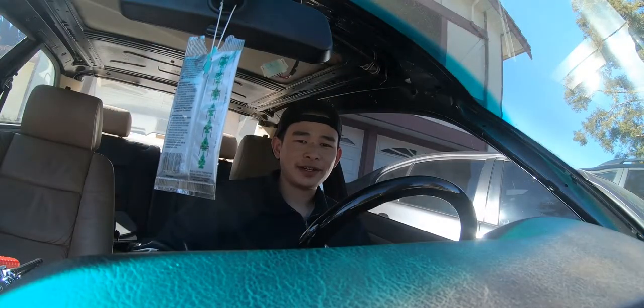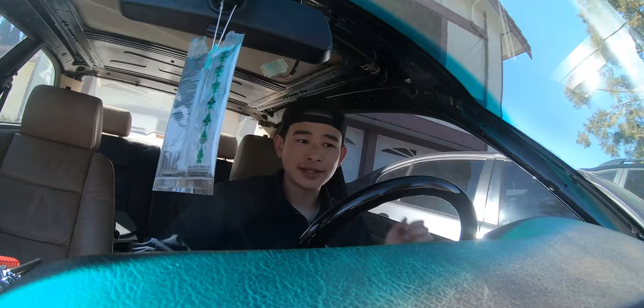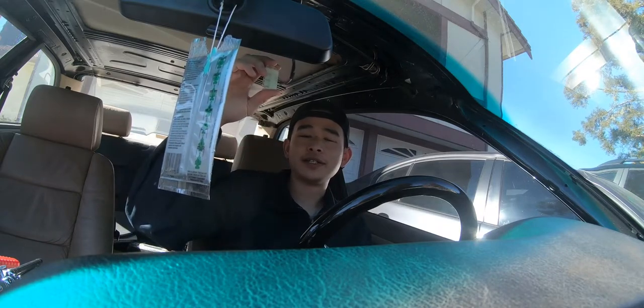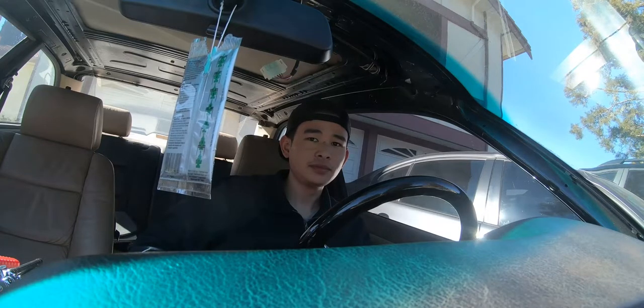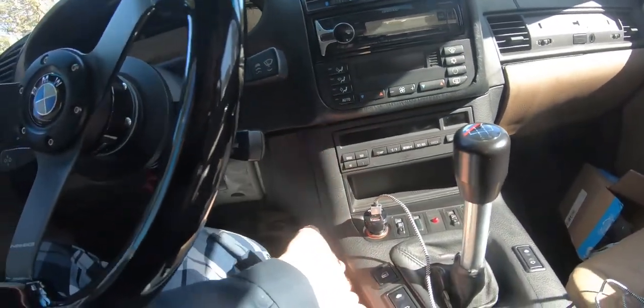So last time I left off I just finished the sound deadening — it's been like two or three weeks since then. I've pretty much put most of my interior back in, except for the headliner and some of that stuff because I'm actually planning on doing a sunroof delete. I've already ordered the sunroof delete panel — I'm going to take out the sunroof cassette, put that panel in, do some bondo, and get it painted so it's like a slick top. Everything else is mostly back in — rear seats are back, carpet's in. I also picked up some parts from my pick-and-pull, like a new armrest.